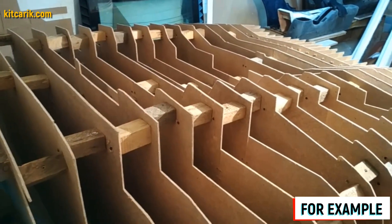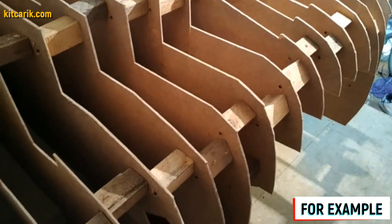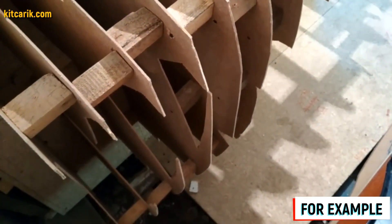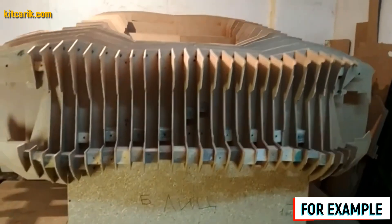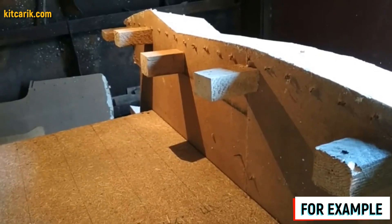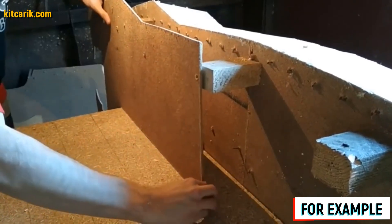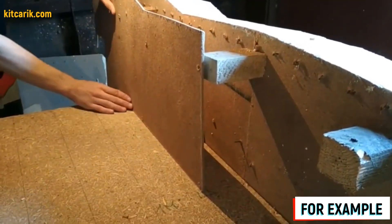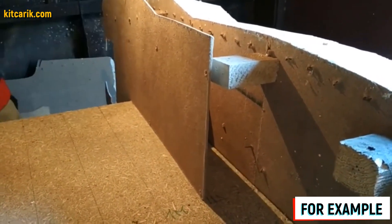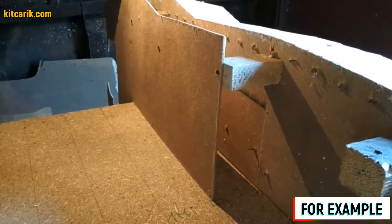To assemble the car buck we need wooden blocks with a size of 9.5 centimeters and 4.5 centimeters. Why this length? The thickness of the fiberboard sheets is 5 millimeters; the space between the main body sections with a step of 10 centimeters is equal to 9.5 centimeters — math. Same thing with the wooden blocks of 4.5 centimeters for front and rear sections. Fiberboard sections are numbered so during assembly we do not get confused. We put the mirror halves of the section together to make a whole section, fasten them, and continue strengthening subsequent sections with cubes of 9.5 centimeters, one line after another.